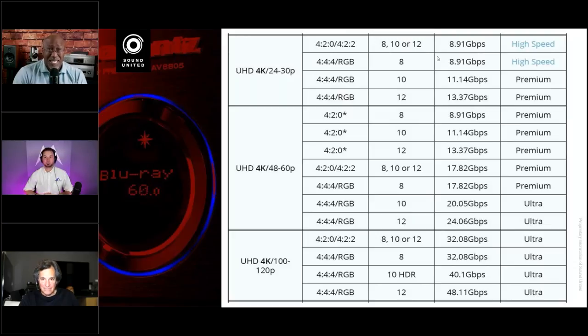The reason I bring this up is that a lot of times, if it says this TV or this display or this device passes 4K 120 or 8K 60, it may not be telling you the complete story. True. You'll see it say 4K 120 with a little A and a little B at the end of it. Well, I can't remember which, is A uncompressed and B compressed? I can't remember which one it is, but one represents compressed and one represents uncompressed.